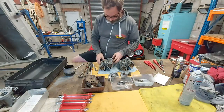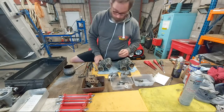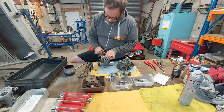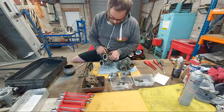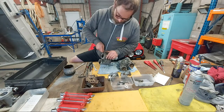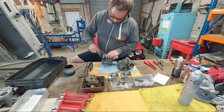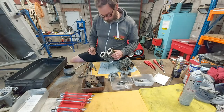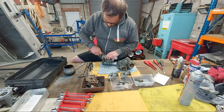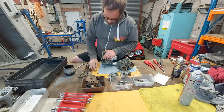Okay, we've got a balance lever here. Need to watch out we don't bend the spindle trying to remove the balance lever, so I'm going to get it to its full stop. So it's basically helping me. Nope, that won't work that way. I'm letting it sit on its idling full throttle stop position, and that's going to help me undo the nut without bending the spindle.